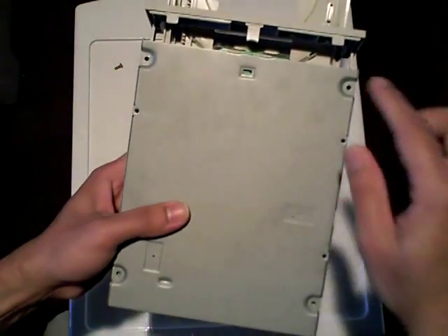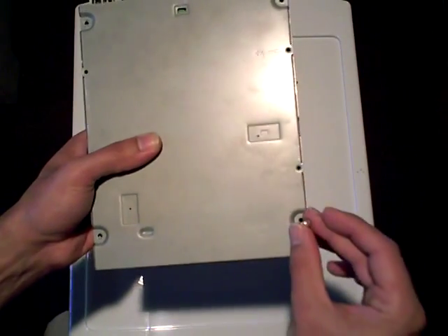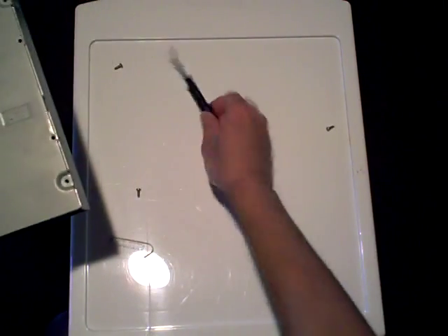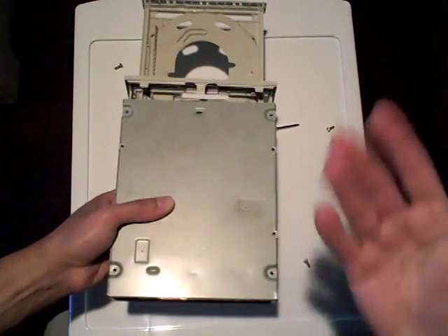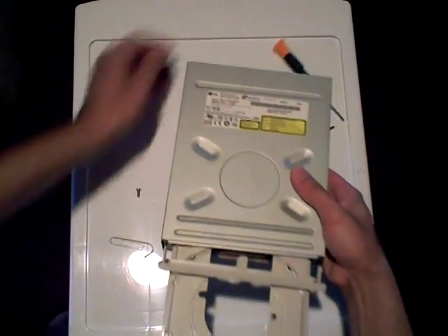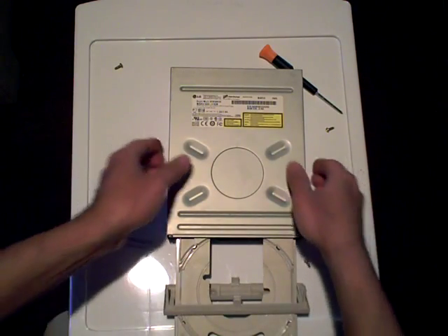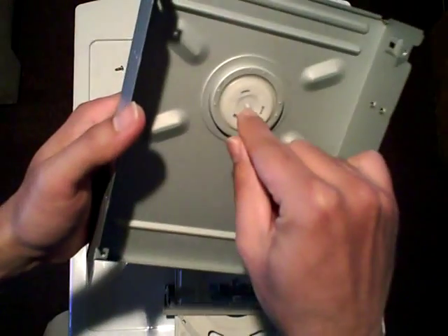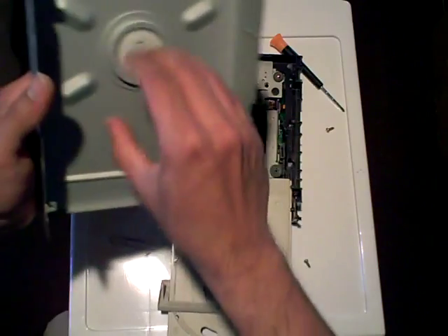From there, what you have to do is you have to disengage the four screws at the bottom of the casing, the housing. Four simple screws — in this case, it is your standard X or cross pattern, which you use your standard screwdriver to disengage all four. Once that is done, it's important to note that you don't open it with the device on its back, but rather you turn it forward so that it is lying down as intended on the table or surface. With the front fascia disengaged and the tray open, you can simply remove the top metal cover, which has a clasp that will hold the disc in place as the spindle motor mechanism comes up to pin the disc when reading.